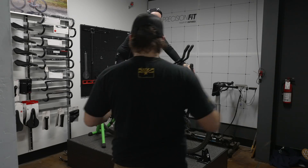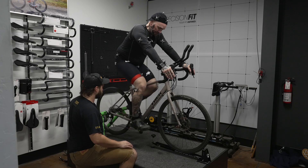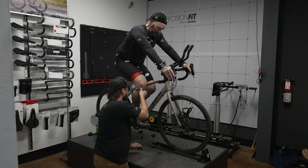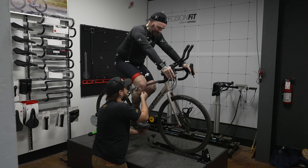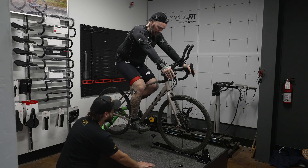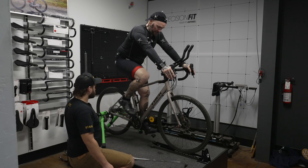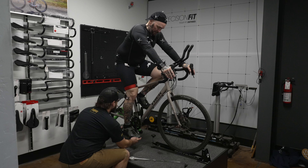We're going to do our knee over pedal spindle check first — slowing you down to a stop with both feet level, right crank pointing forward. You can see we're significantly further forward now because we slid you further forward and it's a totally different design of saddle — you're not having to push yourself quite as far back on it. I'm going to try sliding this saddle just a bit further back, but first I want to make sure we're within range on your overall extension. You're just a tad overextended there, so I'm going to bring your saddle down ever so slightly.